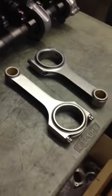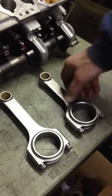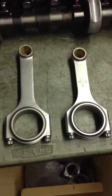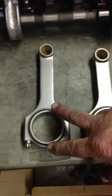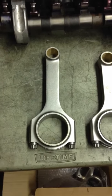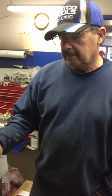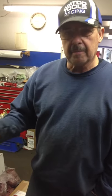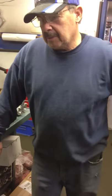Let's talk about the rods we have here. We're running the tall deck motor. This is the rod we used to use in our 3.2s and still do, which is significantly longer than the stock 280 rod — about four or five hundred thousandths longer. And this rod is another four hundred and fifty thousandths longer than that. The benefit of the long rod and tall deck motor is that we get extra torque from the longer stroke, plus the longer connecting rod allows the engine to rev — this motor will easily turn 8,000 RPM. With race gas, we'll get over 400 horsepower, but on the street we should be able to get 370 to 380.